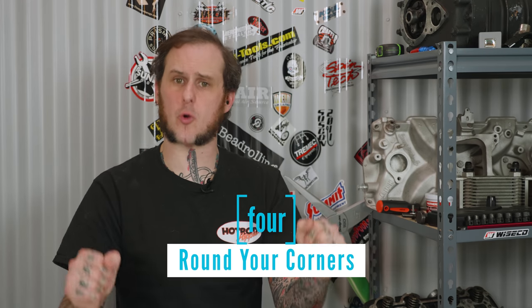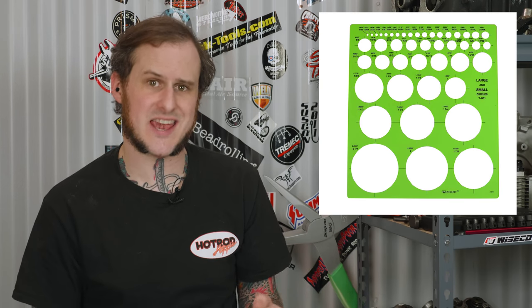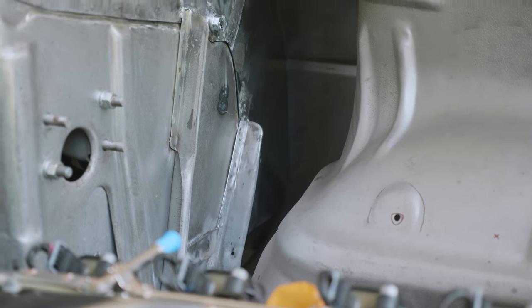Number four is round your corners. Say I was making that floor access plate for a fuel pump — I'll cut that out and maybe it ends up square or rectangular with sharp corners on it. Now you can just leave it and bolt it down; it might even be under carpet, so who cares? I care personally — the little details matter. What I'll do is grab my circle template or radius gauge, go over to that corner, and mark a radius on it — whatever is going to complement the piece best, whether a bigger or smaller one. I'll mark it, go to whatever means I need to cut it — hand shears, a corner notcher on sheet metal, a bandsaw on heavier stuff — and then sand it, grind it, clean it up, deburr it, and create that nice rounded corner.